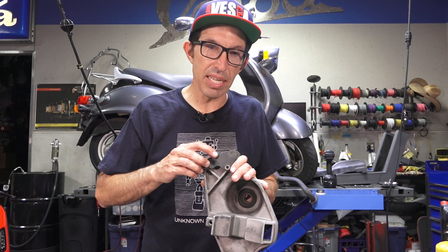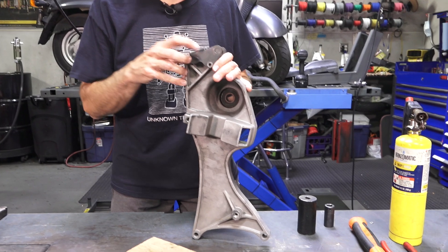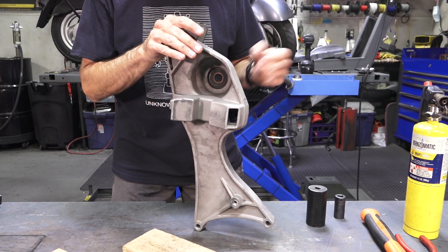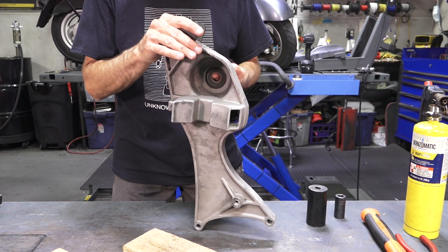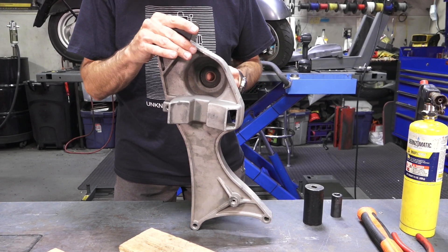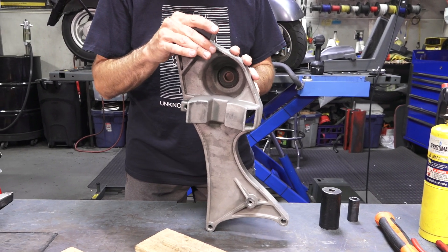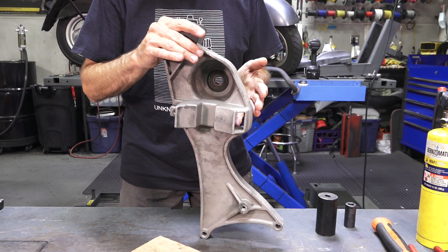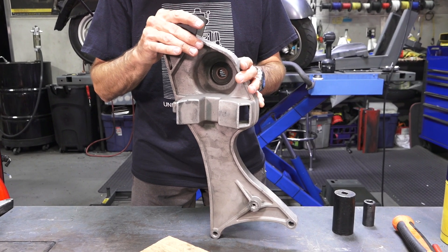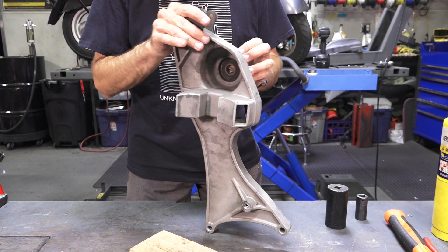Here is the right side swing arm found on a Piaggio 500 motor — very similar on a GTS 300. This is where they have a sealed bearing, and these are the more common ones that fail because they're exposed to the elements. You may hear a rolling metallic noise when you wheel the scooter around. It may be this bearing in the swing arm that supports the axle of the rear wheel on the right side. It could also be bearings in your final drive unit or possibly the bearing in your belt cover.